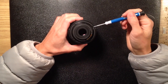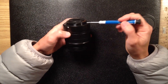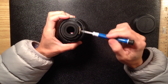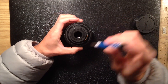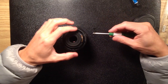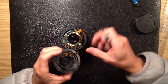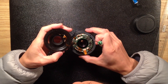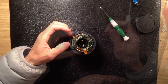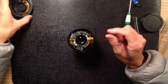So as usual, let's first open the lens from the back. There are four black screws here, and also two side little screws that hold those pins. Let's do it. After carefully removing those four screws and two side screws, we can take off the lens EF-S mount. And this one comes off as well. Put aside.